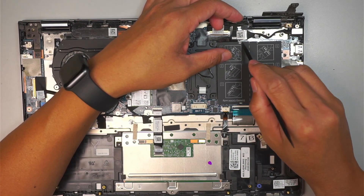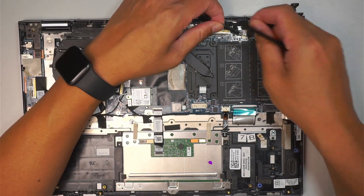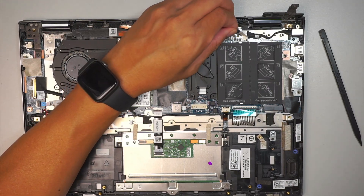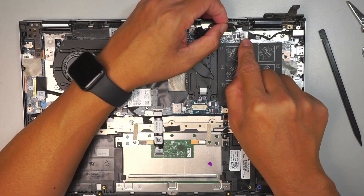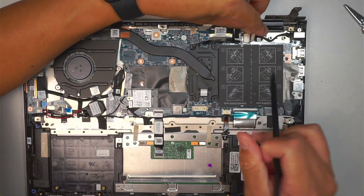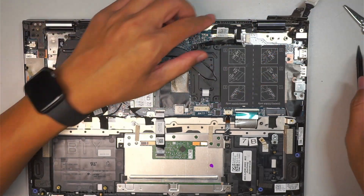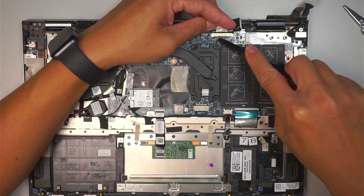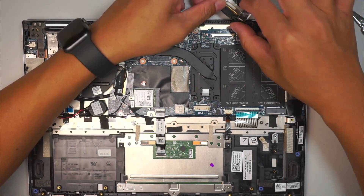Here comes that little DC jack connector for your power. We need to peel that little tape backwards — you can give it a little cut because the tape is tipping down to the other side. This is the DC jack; peel the tape back and then push that connector to the right to disconnect the DC jack. This is your LCD screen connector — there's a little clipper here. Go ahead and flip the clipper open and slide that connector away from your body to remove it.